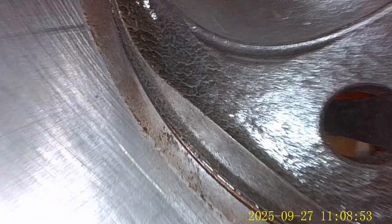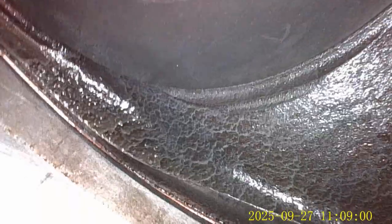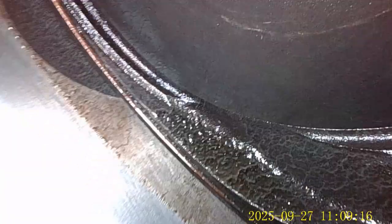One of the things I'm trying to show you is that on the Cleveland, they have the cylinders notched. The cylinder bores are actually notched to help prevent shrouding of that intake valve because it's so close to the bore wall. I think big Chevys have an issue with that too. So that gives you a good view of that area — how close it is. That's what you want to make sure you got cleaned up to prevent intake valve shrouding. That makes a huge difference in flow. That's why it has it — because the valves are so big in that bore.